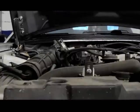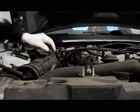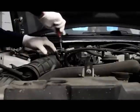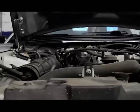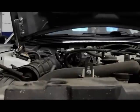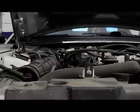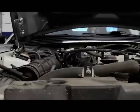We'll give it a little shot of ether. Make sure we reconnect the snorkel tube — you don't want to fire this up with the tube disconnected because you have an air flow meter that has to sense the flow of air past the meter. So we reconnect it and give it a shot. Now we know it does run when we give it a little shot of ether.